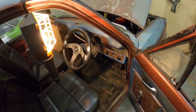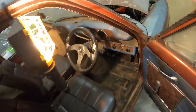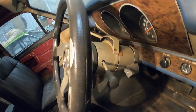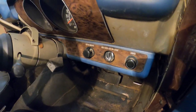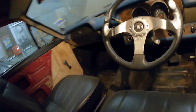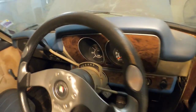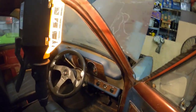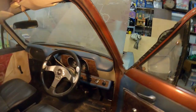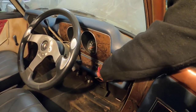If you've seen my other video, I was saying that GTR has all LJ parts in it. Well, you can see here the difference. We've got an LC column - there's no key on there - and then the under-dash there is LC. It's got the different setup there - obviously the LC dash with the ashtray in the middle and the two humps, and then over here you've got the fan and everything in the middle. It's also got a little patch on the floor there where the four speed or three speed would come through, but it's actually column shift auto. So I did say three on the tree before - I meant column shift auto, which is different obviously. So yeah, that's what we've got in here. Yes, I am putting it off, because I'm a little bit nervous. It's been a long time. But let's just see.